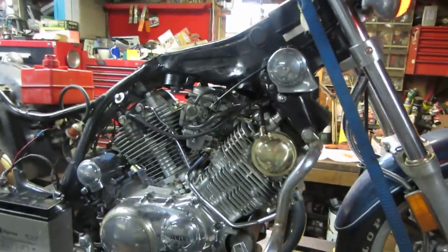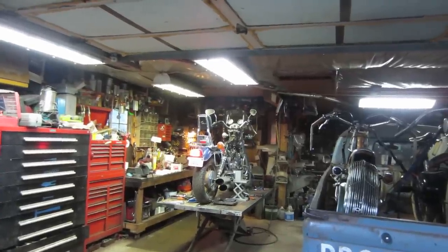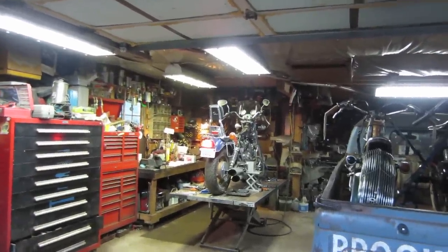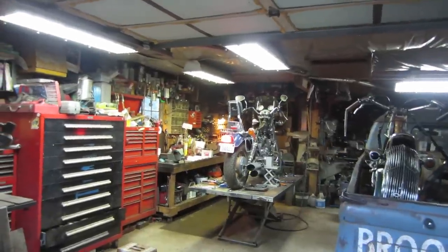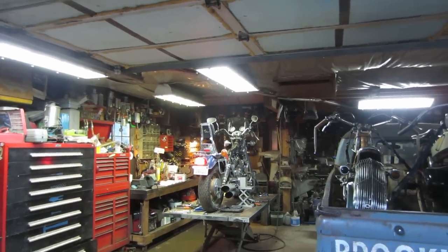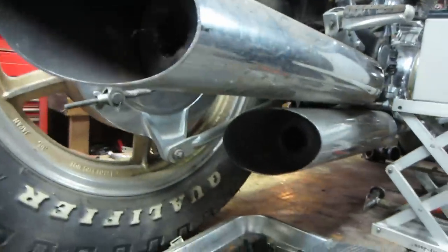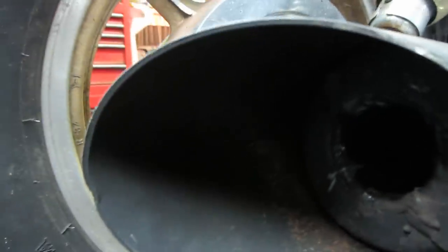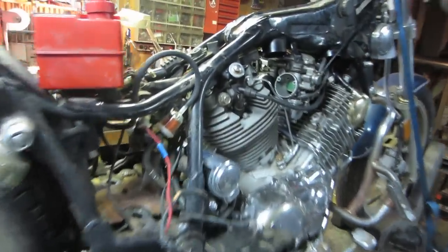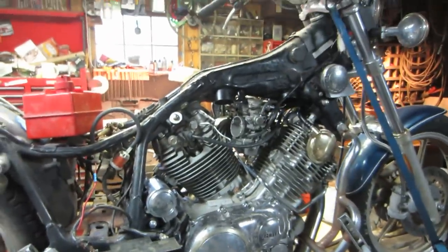I'll let her warm up and see how she makes out. It's been running about 10 minutes or so. I had to go tweak it — I had one of the vacuum lines off on the front cylinder so it wasn't coming in at an idle. Put that back on and it came right back. I'm just playing with the balance a little bit, feeling the pulses of the two cylinders to see that they're pulling evenly — not one cylinder popping more than the other. I'm happy with that. The battery actually works fine too — it doesn't have any drag trying to crank it over.